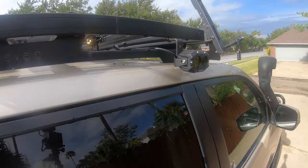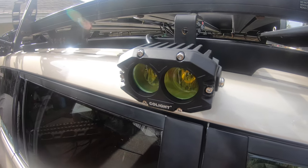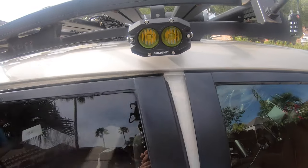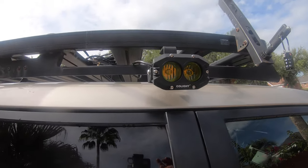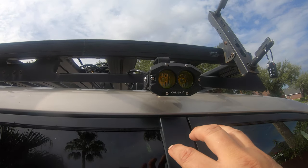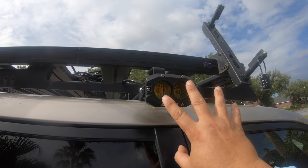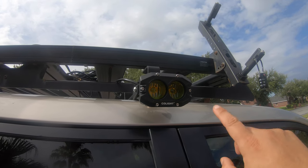The next one was a little trickier — it needed a bend so I could drop the light a little lower compared to the other one, to clear the recovery boards while still keeping it where it won't interfere with the door. Speaking of the lenses — if you remove these little hex screws, the lens comes out and you can replace it with whatever you want. If you change your mind from amber to white, or want spot for ditch lights, you can certainly do that.